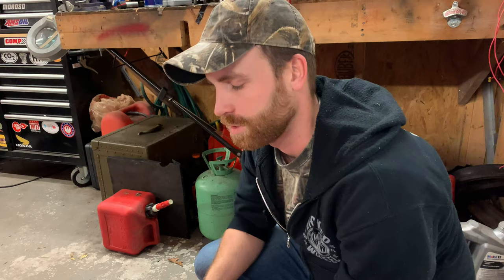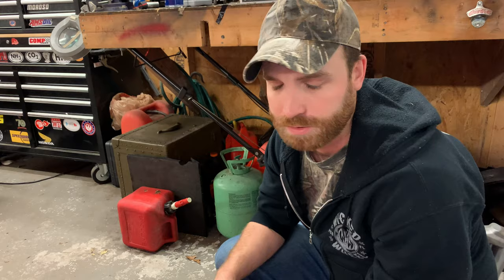This is also the part where you actually get the most wear on an engine when it's brand new — everything's breaking in. Especially on an air-cooled VW engine, oil temps are higher. These camshafts in these cars are flat tappet, not rollers, so you've got metal on metal riding together. And they are not hydraulic lift camshafts — they are solid lift. So oil is very critical.